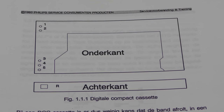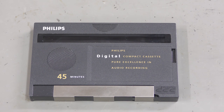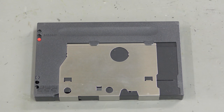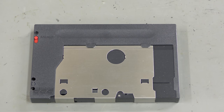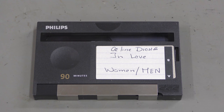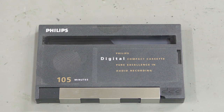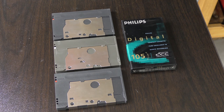The design of a DCC shell is totally different than a regular analog version. Not only was different tape used — the BASF CK5021, which is basically a chrome video tape — but there were also several holes in the DCC shell to let the player determine the length of each DCC tape. There were 45, 60, 75, 90, and very few 105 minute versions. The metal slider is to protect the tape.